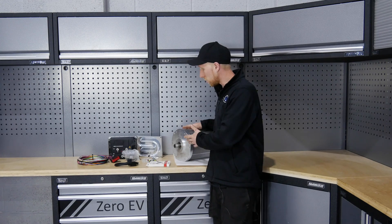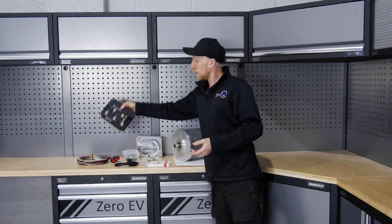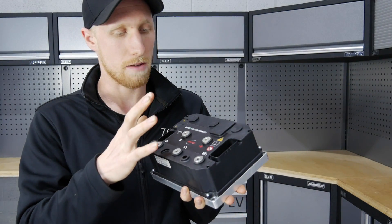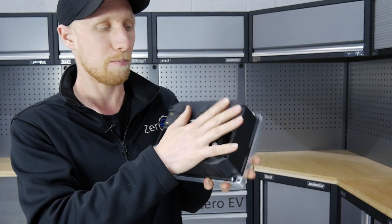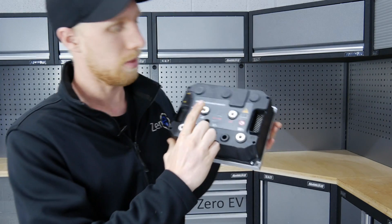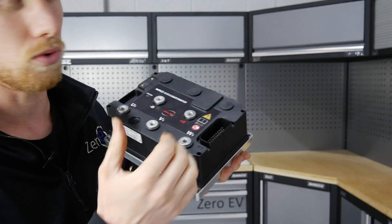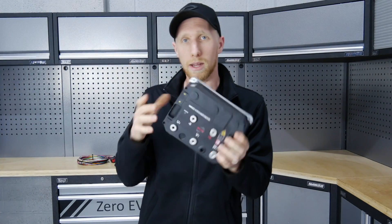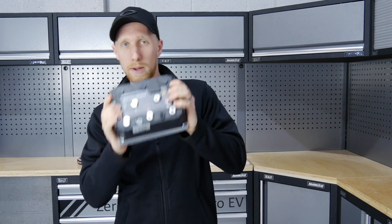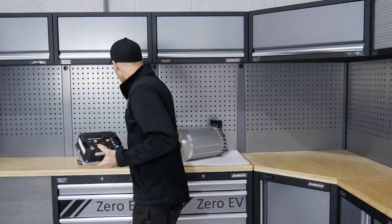You get it as a kit which includes the motor, the controller, IO looms, a couple of connectors, and a contactor. The controller slash inverter is one piece - you don't need a separate vehicle control unit as it's all done within here. It takes your throttle, brake signals, and gear selection - drive, neutral, reverse - and has your negative and positive battery connections, three-phase outputs to the motor, and the main IO loom which is 12 volt with ignition live and CAN bus. It interfaces with our Orion battery management system - if the Orion reports low charge or the batteries are getting too warm, it communicates via CAN bus and limits the motor to protect the batteries.